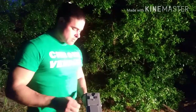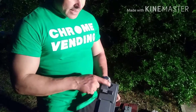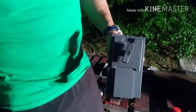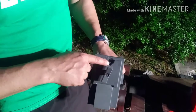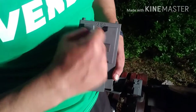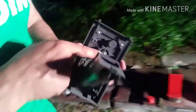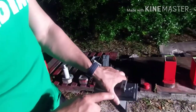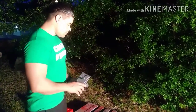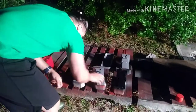I had a couple questions about the paint scratching up once you paint it. A lot of times this will wear just from people's fingers, especially around the coin slot area. What you can do is put a quarter in there, turn it so the slot is covered, and paint with that part blocked — as soon as the coin goes through, that area will still be gray but won't be scratched up. You can also go to the back of the machine, unscrew this part, and pull the knob off while you spray it, so you can leave those areas gray and they won't get scratched. I'm gonna put this quarter in, turn it halfway, and spray it so you can see how that comes out.